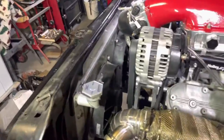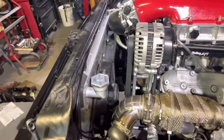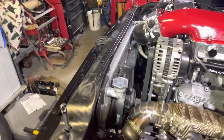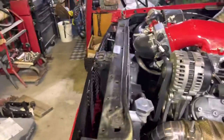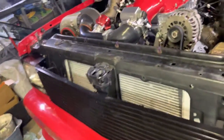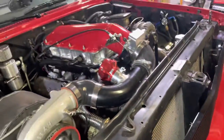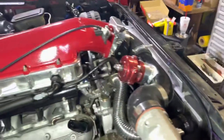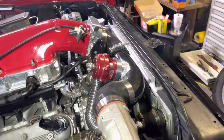I definitely prefer the Superior Radiator if you have the money — it's roughly $700. You could do a 4.3 radiator and Dodge Intrepid fans for ballpark $300–$400, even buying both brand new. You could also do a 4.3 radiator with Flexalite fans — they make really good slim-fitting fans that can go on either side of the radiator as pushers or pullers.